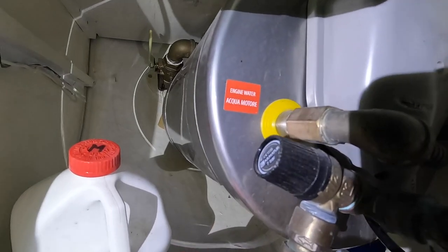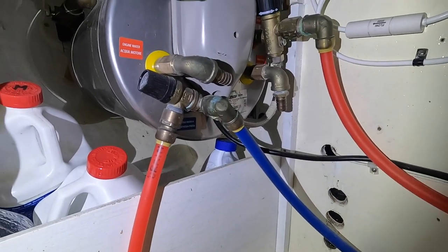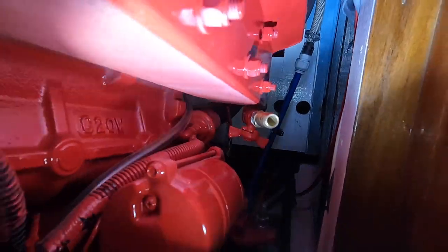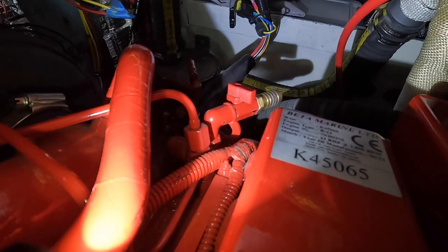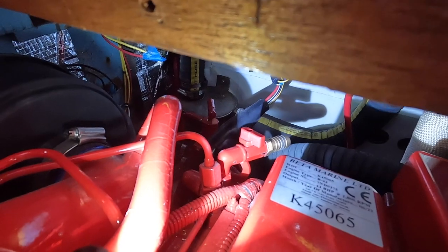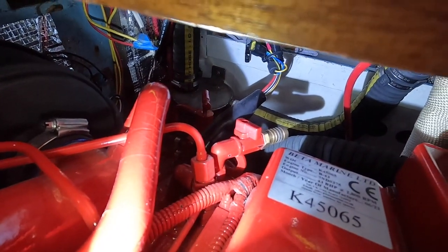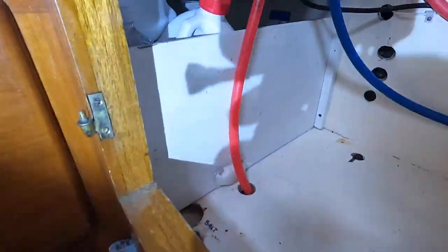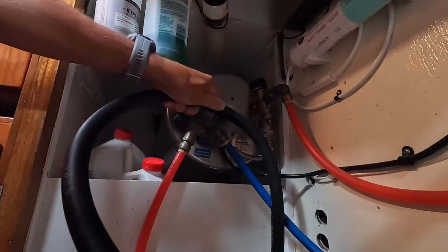I don't like the idea of thread sealing compounds in the cooling system. I just need to route the hose through the holes in the floor, connect them to the engine, and then bleed all the air out — run the engine for a little bit, let the thermostat open up and bleed the air out of it. When we ordered the engine, we had valved takeoffs installed — one underneath the heat exchanger and one on the back of the engine. I got those rotated around where I didn't need any standard NPT fittings. Everything has to exit and come forward under the floorboards and up into the water heater closet underneath this cabinet.